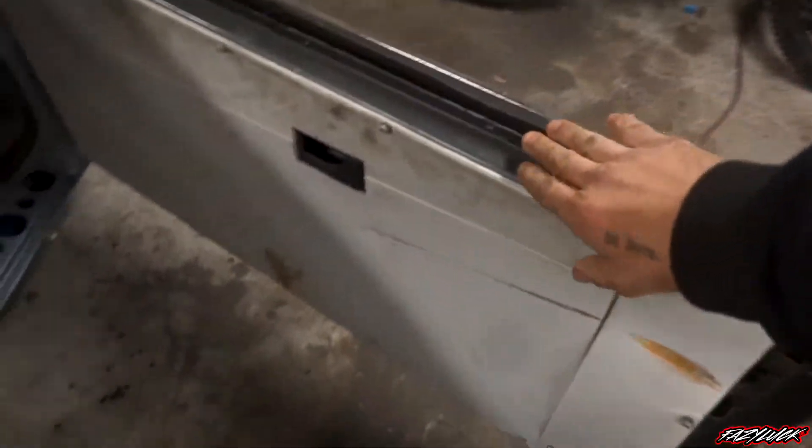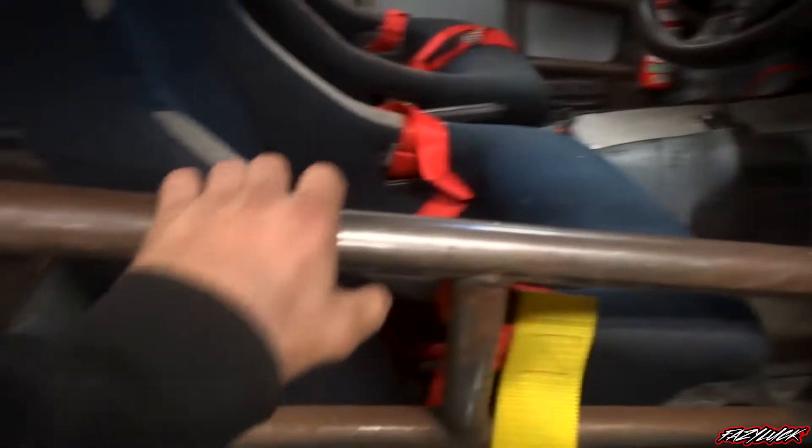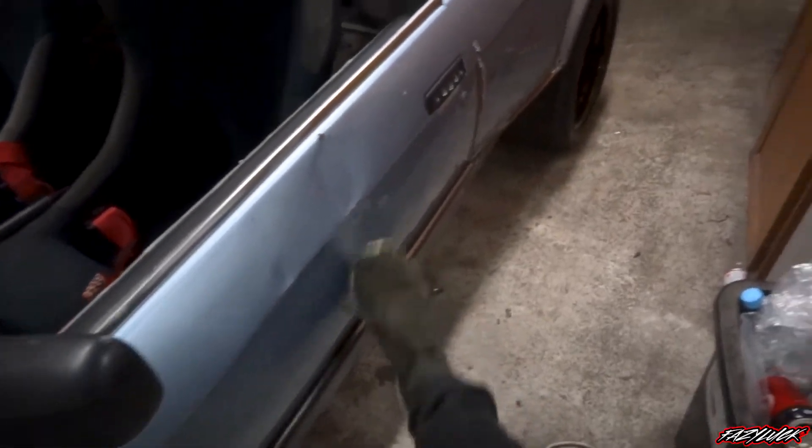I need to match this door — I haven't pulled as much weight out of this door as I have the other one. In a minute you'll see there's a heap more holes and steel cut out of that door. I want to strip the interior, get it painted white, and finish off the homologation for the cage — I just have to send off the paperwork. I did notice when I drove it across town that there were basically no brakes, or pretty much nothing. There's a leak somewhere — looks like it might be through one of the bulkhead fittings in the firewall, which worked sweet at the wedding, but I wonder if constantly holding the brake on during the wedding sprung a leak because I'd only just finished it before that.